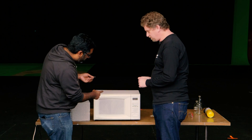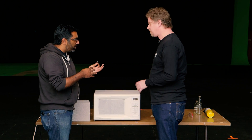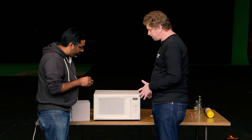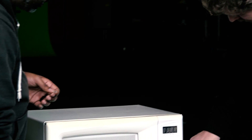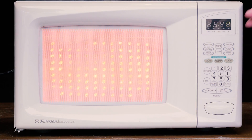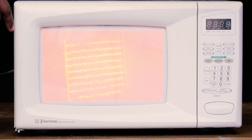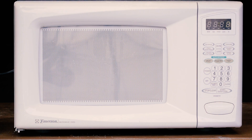It's simply the microwave hitting them. What I noticed in there is that the pattern of colors would go on and off. So as the microwave rotated — the generator of the microwaves on the inside, called a magnetron, sends the microwave radiation inside the chamber and it bounces all around. In some places it's more powerful, in some places it's less powerful. It glows more where it's more powerful and less where it's less powerful. Sometimes one bulb will block another, absorbing the energy so it can't reach another neon bulb.